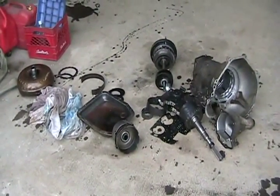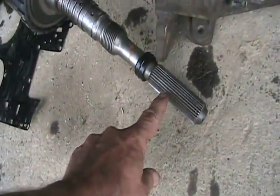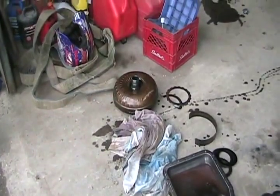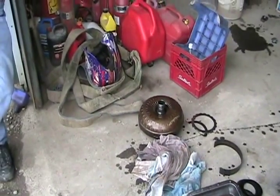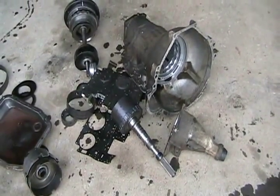This being a four-speed automatic overdrive transmission, that means it has a circle around the D on your selector. Overdrive means the output shaft of the transmission — which goes to your drive shaft — is spinning faster than the input of the transmission from the torque converter, so it's overdriving. On a three-speed automatic, that never happens — third gear is always the output shaft spinning at almost the same speed as the torque converter. The reason it's not spinning at exactly the same speed is because torque converters have some slippage, unless you have a lock-up torque converter. Then when you're driving on the highway, the RPM of the motor is the same as the output shaft of the transmission.